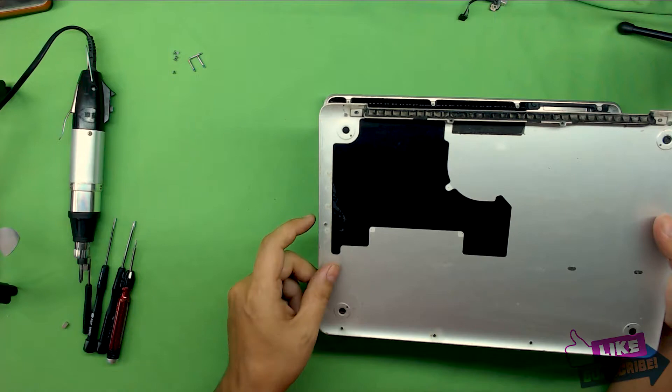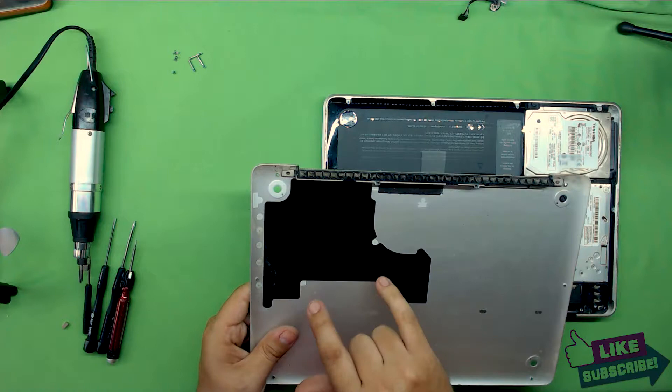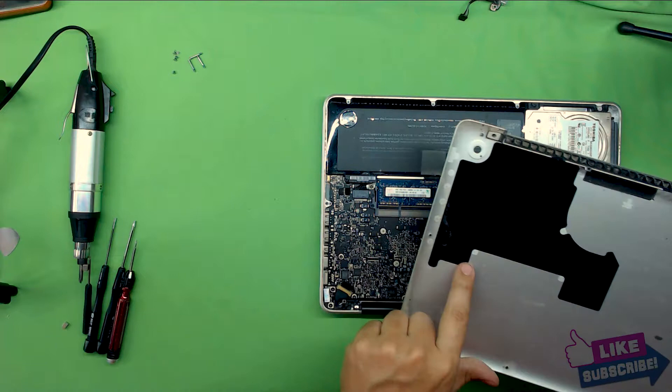Make sure you clean this — it has lots of dirt on it. On this part here you can count the pads: I only counted eight and there are nine here. So that's another reason sometimes it doesn't turn on. Dirty or poor-contact connections on these nine pads will prevent the laptop from booting.